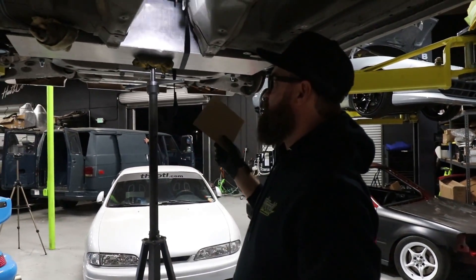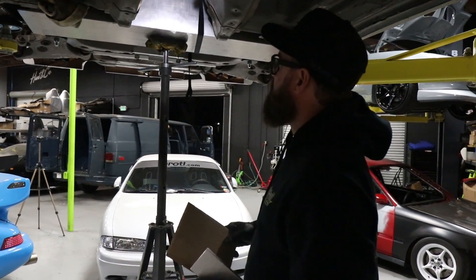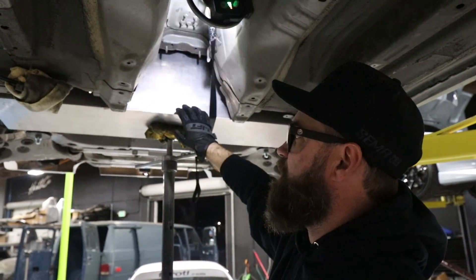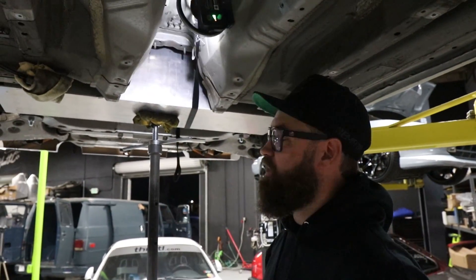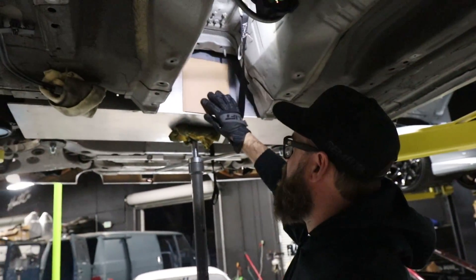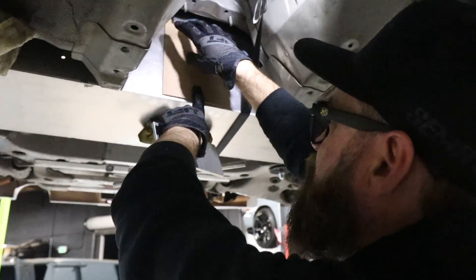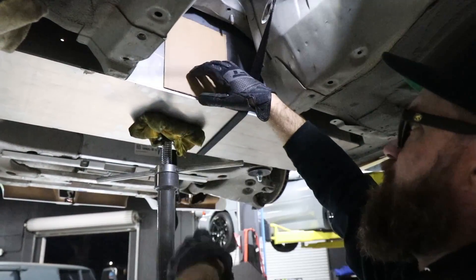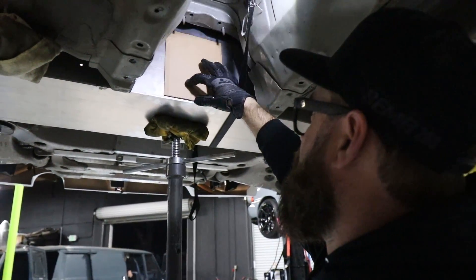You've seen us put these battery boxes basically up inside the car, but now is the time to actually permanently mount them. We're going to go ahead and use a provision that's already on the chassis to build a mount for the front of this rear battery box. I've already made some CAD-designed templates — cardboard-aided design. These are going to go on the box and be welded to it. We're trying to distribute the load onto the box, so we're going to build a big plate that's going to weld onto here — probably do four or five rosette welds on there to basically make this plate become part of the box.